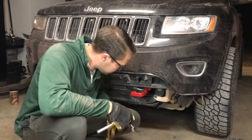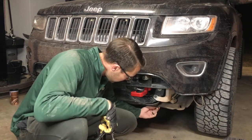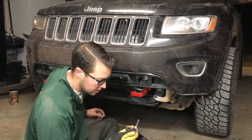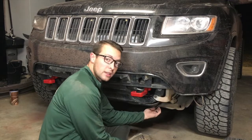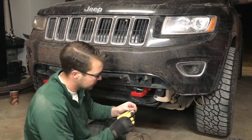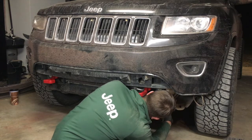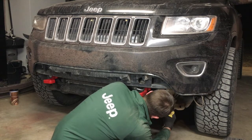A piece of advice: this little reservoir is in the way, as well as this cloth under-protection. You're going to need a 10 millimeter to take this off so you can get your hand back to reach the back bolt. It was kind of a pain to get to, but I got it on. It's just tricky — take your time. You don't want this falling off. Then just reattach the cloth felt piece.